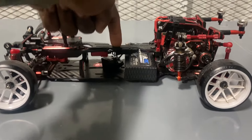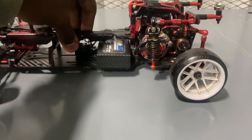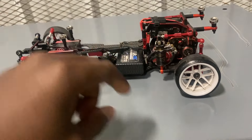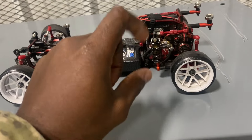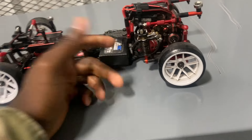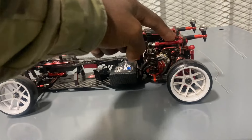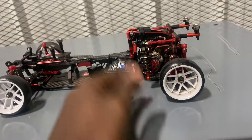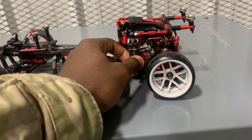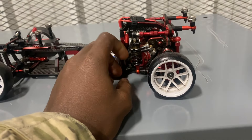I really focused on trying to make sure I could push down the middle and have both the front and the back move because I wanted this weight shift effect. That's what everybody's doing. So, 20-weight in the front, 20-weight in the rear, dead dampening — close the shock all the way, screw the cap on, and that's what you have. This affects things greatly.